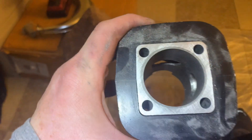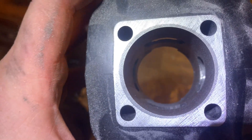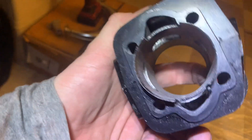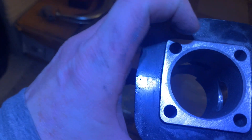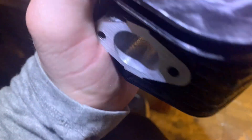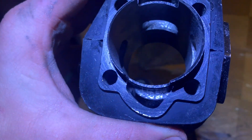I did the top, and you see the two colors in the middle — that's the iron sleeve. So it definitely has an iron sleeve. I knew that just by the way all the ports had like a sixteenth or eighth inch thick piece of metal in front of all the ports. It labeled it as a sleeve cylinder, and it also said it was a hundred CC, which it's obviously not since it's a 47 millimeter bore. It also says 70-80 right on the outside — that was the giveaway that made me open it up and measure it. Either way, we are grooving. Very happy right now.